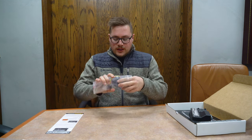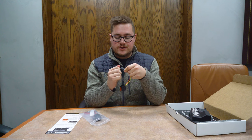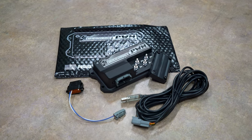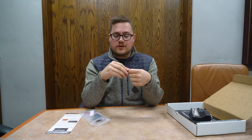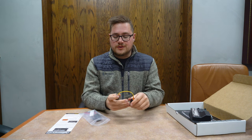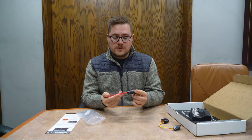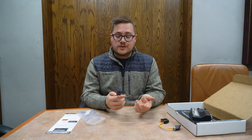The hardware kit is going to include nearly everything you're going to need to start the PWM up and get your motor running. Included is the 12-pin mating connector, plus a two-pin connector we use with our RS-485 to USB cable. You simply plug the cable in and then plug it into the PC to configure the entire controller. The kit also includes a fuse holder and 30-amp fuse, which you'll want to place about 18 inches or closer to the battery.